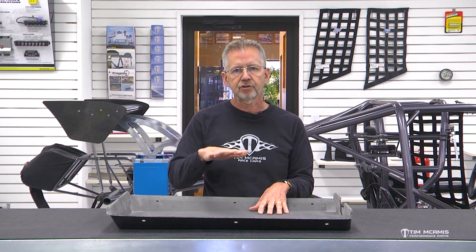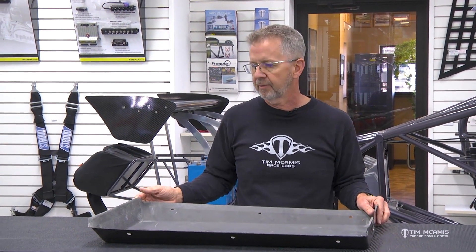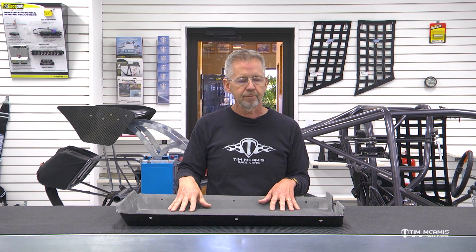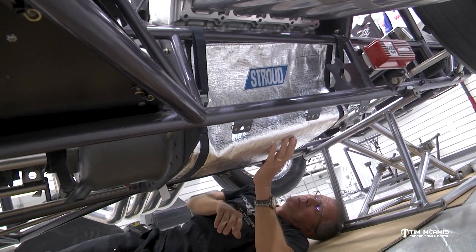We still want to keep them up tight. We want to have that clearance from the racetrack so that you don't have any problems with the starting line — breaking the beams or getting any false readings at the start. The dimensions are on the website, giving you an idea of how much they're going to fit below the frame rail and below the pan. You can trim this to bring it up more or less — it's going to come in a pretty close fit, but you can do a little trimming if you want to bring it up tighter. It takes probably two hours to mock it up, fit it, and put it on. Your diaper will go on, then the carbon belly pan pops up on there — it really is a nice option.